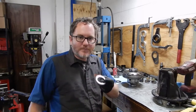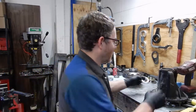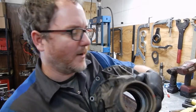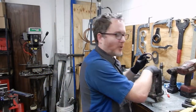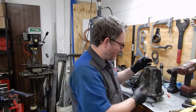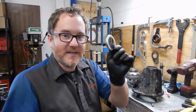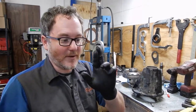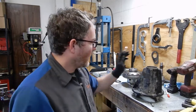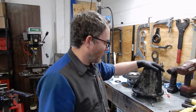The most important thing is that the 80 series front diff is high pinion. It's got this extra oil slinger that goes in the diff housing down here behind the outer pinion bearing. This helps keep an oil bath up in the bearing so it doesn't drain back into the housing as fast. When you pull the bearing races out, this gets mangled. They're really cheap from Toyota, so if your master install kit doesn't come with one, go ahead and order it from Toyota. Otherwise you run the risk of oil starving this outer bearing and prematurely cooking it.